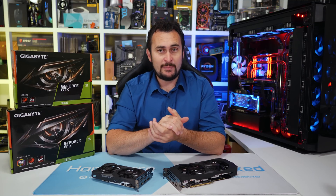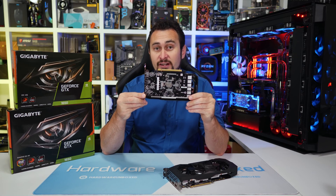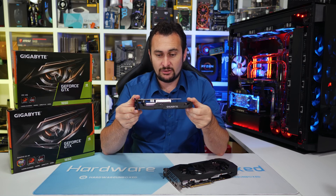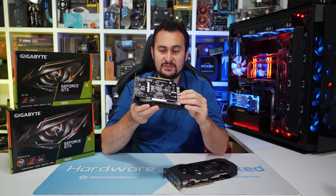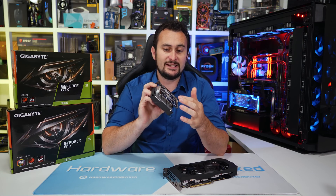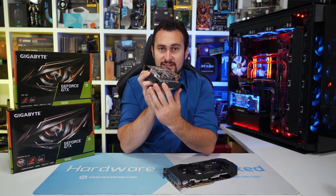So with the help of our lovely Patreon backers, I have purchased the Gigabyte GTX 1650 OC. This one is 195 millimeters long, so it's quite a short graphics card, and it weighs just 377 grams — extremely light for a graphics card. You can see how small it is and it doesn't have a particularly large aluminum heat sink. Most crucially, the reason I purchased this card is because it doesn't have an external PCIe power connector — there's no six-pin PCIe power connector on this card, as you can see. So it is limited to 75 watts.